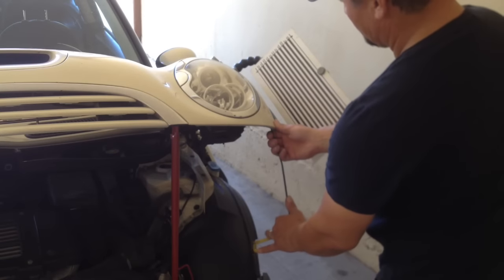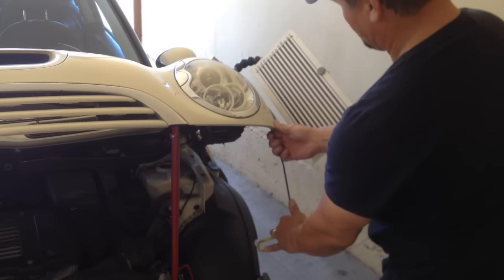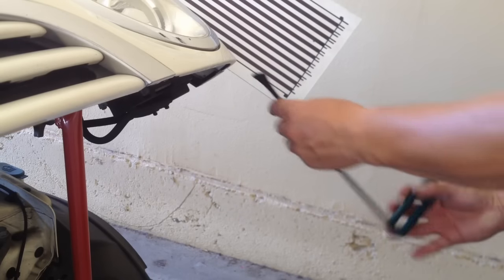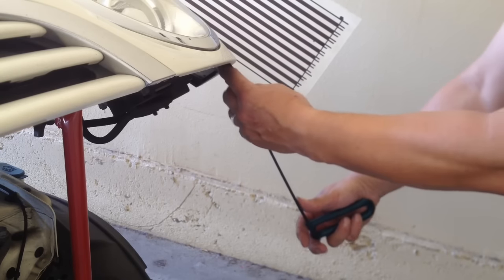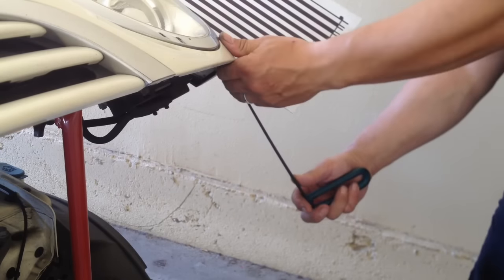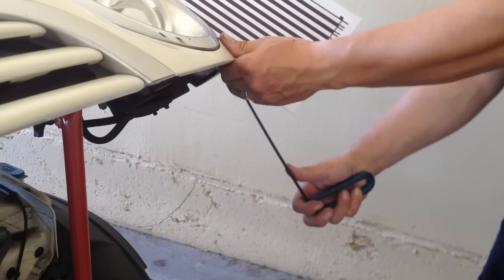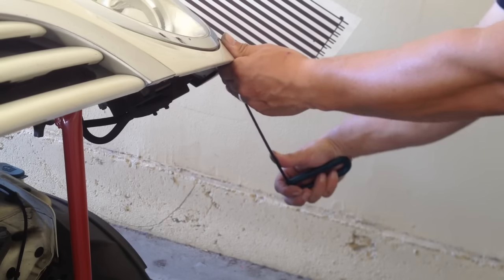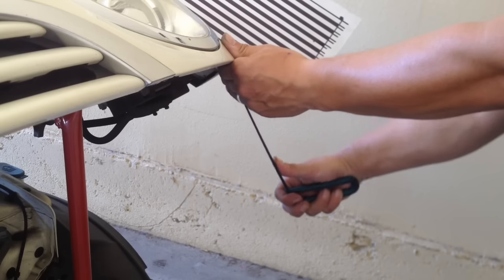The first and most important key is to be patient while working the dent. If I work the dent too fast, I could cause dimples that can't be worked back down, or worse, crack the paint. I hold and maneuver the tool to provide the maximum amount of torque. This allows me to maintain precise control of the force necessary to lift the dent without overstretching the metal.